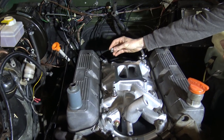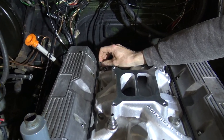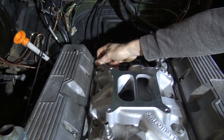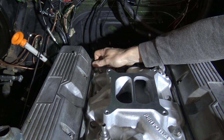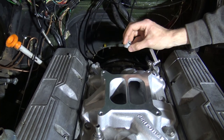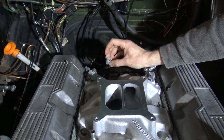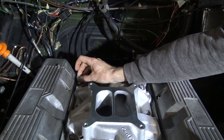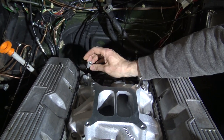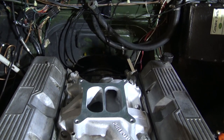One little tip on the intake manifold: there is this little stub sticking up here. You can install it with that in place and many customers do. However it does just squish the rocker cover gasket if you've got the rubber rocker cover gaskets, as most of these engines do. So just removing that with a grinder - obviously pre-installation, making sure no swarf goes down the intake port - is a little top tip.